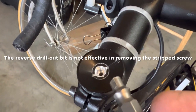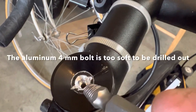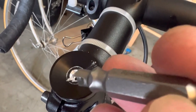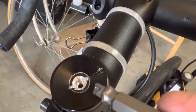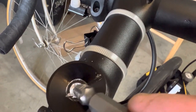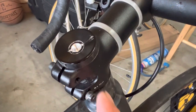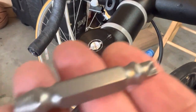I had no luck taking out this aluminum bolt. I've completely rounded the head. Since the bolt is made of soft aluminum, the first drill bit was not effective. Now I need to completely drill out the head of the bolt and then possibly change the steel tube insert inside. So yeah, it's a lot of work — that drill bit doesn't work anymore either.